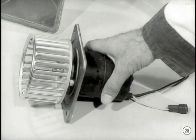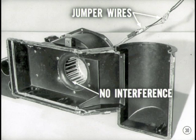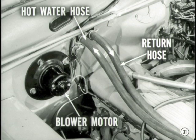Yes, I've got a few suggestions, Paul. First of all, since you must remove the heater assembly from the car to remove the heater core or blower motor for service, here's a tip to remember if you've loosened or moved the blower on the motor shaft. Normally, there should be between 15/32nds and one half of an inch of clearance between the blower and the motor mounting plate, but this dimension varies with individual heaters. So after you've installed the motor and blower in the heater housing, but before you put the heater back in the car, hook jumper wires to the motor and run it to be sure there's no interference between the blower and the housing. When you install the heater, be sure you don't get the hoses reversed. The hot water hose from the cylinder head should be attached to the heater tube closest to the blower motor. The return hose that leads to the water pump should be attached to the heater tube farthest from the blower motor.